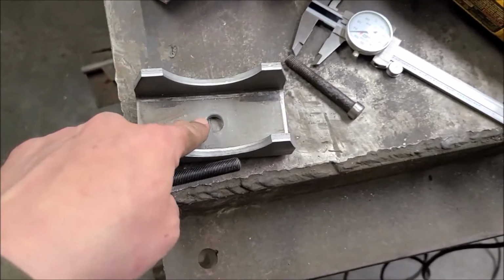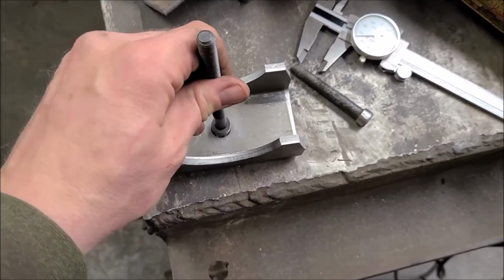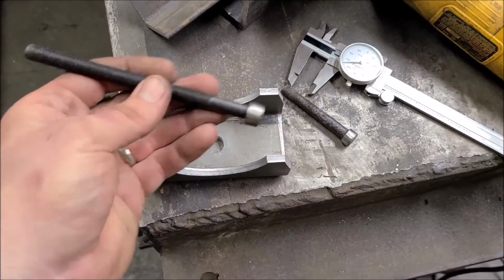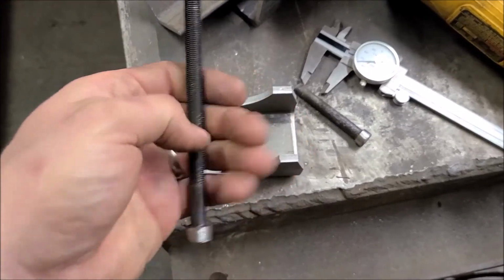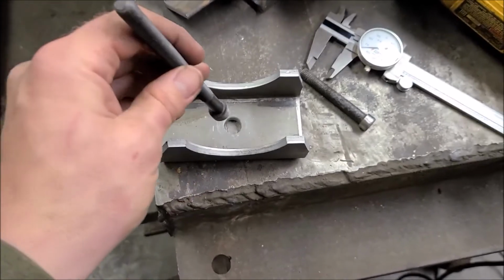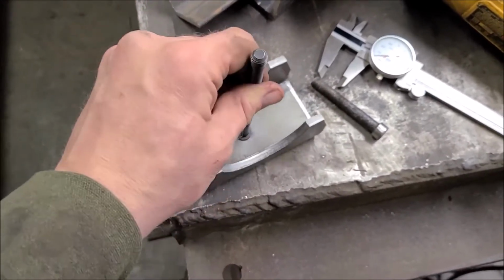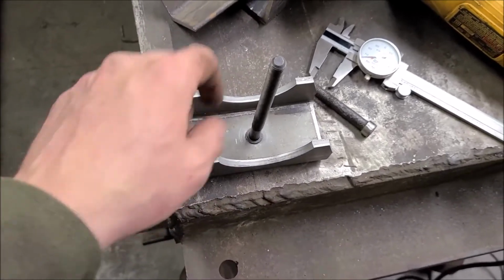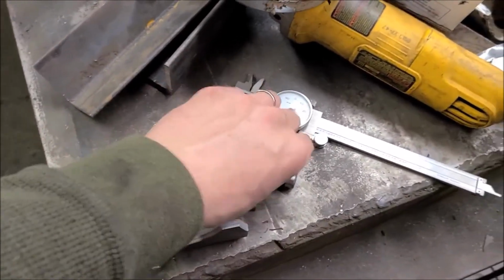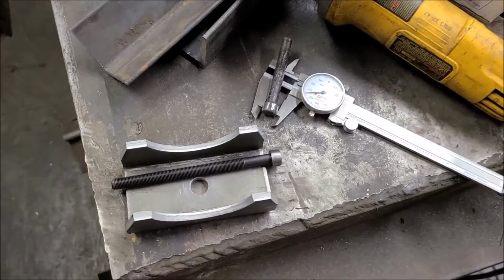So I did some measuring, and then I drilled this out to 9/16, and then this was still just a hair too big, so I ground on it a little bit to clean it up, and now it fits in there nice and tight. But there's apparently more variables in these than I realized. I thought, well, I'll buy a brand new 1/2 inch head with a 3/8 bolt, and this is supposed to be 1/2 inch, but it was larger than 1/2 inch by quite a bit. So maybe there's just a lot more variables in these pins, with a lot of different sizes used across different vehicles. But anyway, that works fine. I just again drilled that to 9/16 and ground the head down a little bit. Now we've got a nice snug fit, so we'll go forth with that, which is good. This pin was pretty rotten anyway, so now I don't have to reuse it. These were cheap, so we'll go with that and then cut it down to length once it's installed.